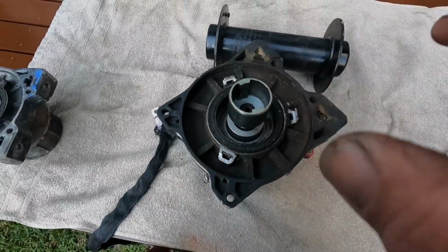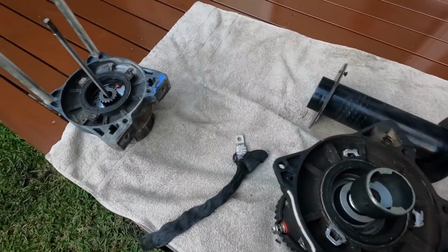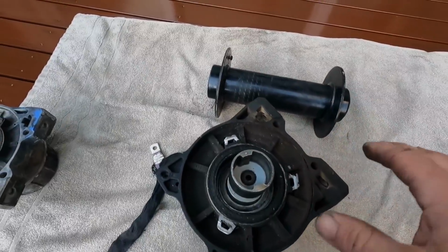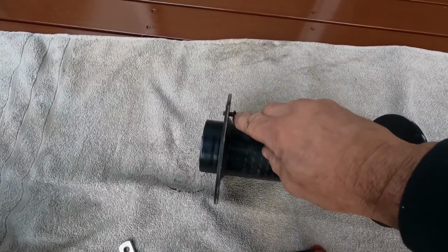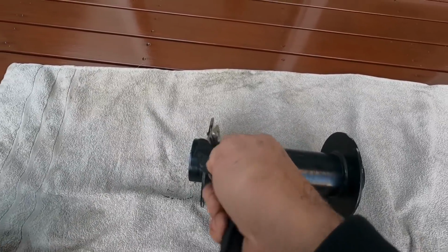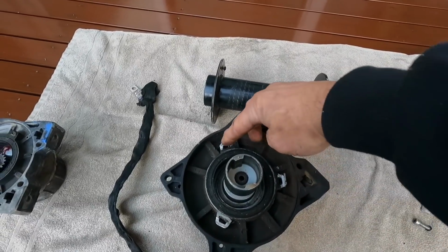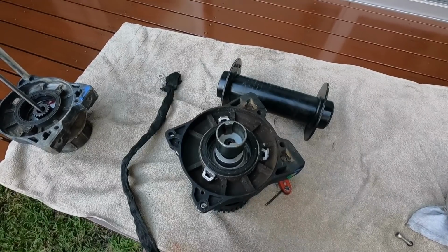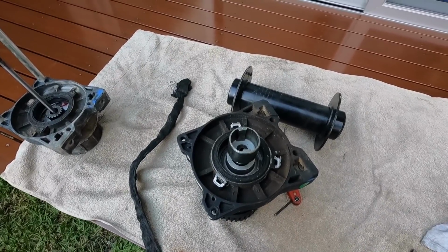So it's not going to affect the working capability of the winch. What we'll do now, I mean, the damage is done, I'll put a couple of washers in as spacers when I refit that lug, which will bring it up off the housing, and it'll go again. So this was a driver error again on my behalf.